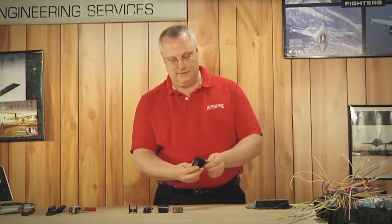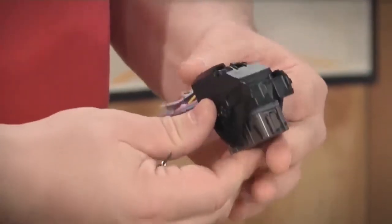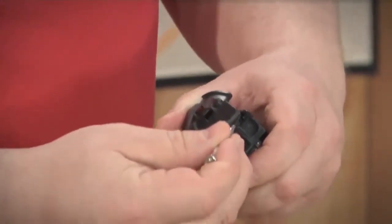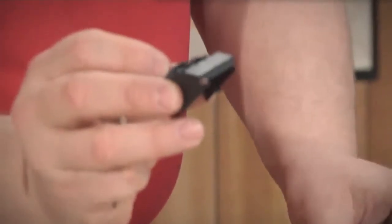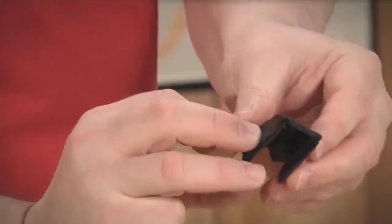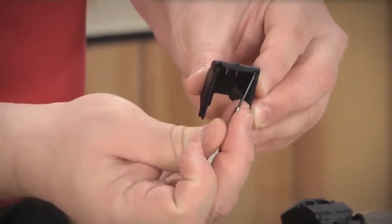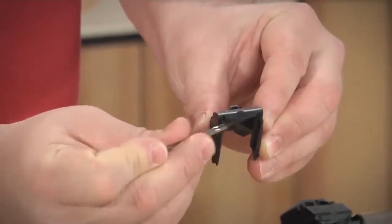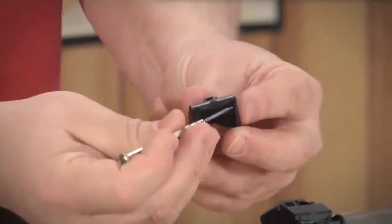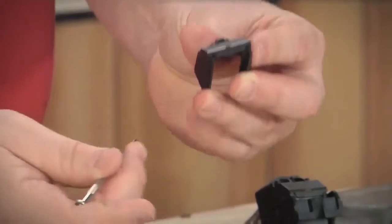You're going to come up to the connector housing, lower the locking lever, and then with a little bit of pressure from your thumb, release two tabs — one on both sides of the cap. There's a locking tab on one side and one on the other side as well. Take your precision screwdriver, push one lever out of the way, then the other, and slide the cap off.